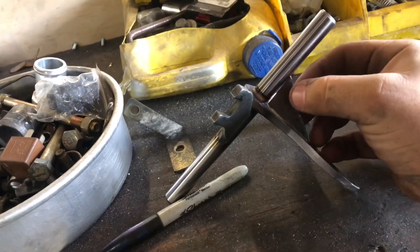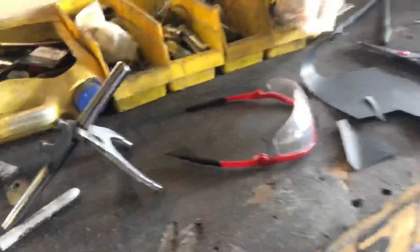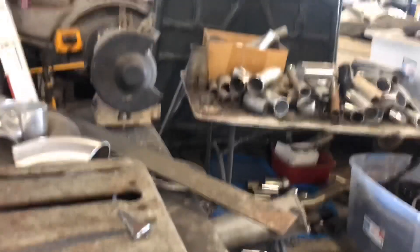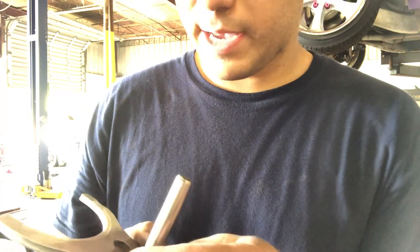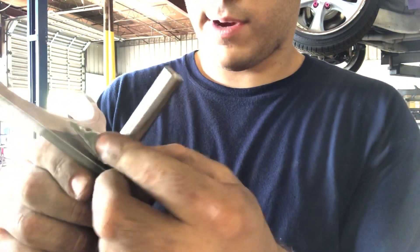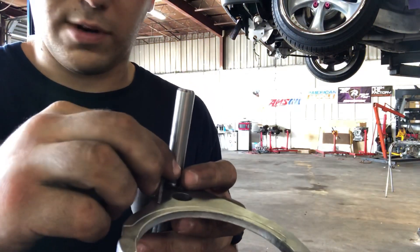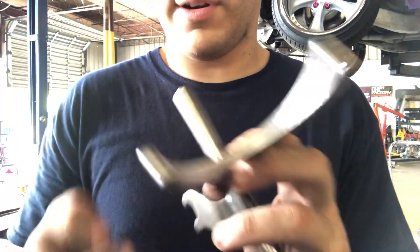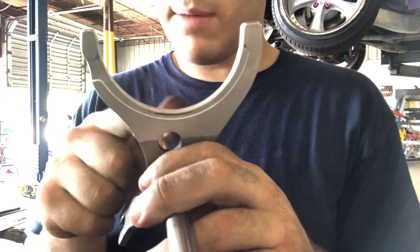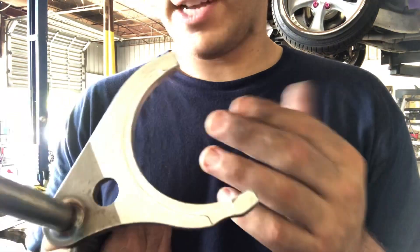It's going to sit like right there roughly — give or take — I'm going to shave it down to fit. There are two pieces; one is a little bit larger. I think I'm going to put the larger one on the big end and weld it around there, and then the smaller one on this end as a support. They designed it with a hole right there — I'm sure there's a specific reason why — but I think that hole actually weakens the selector fork, so this should help out a lot.